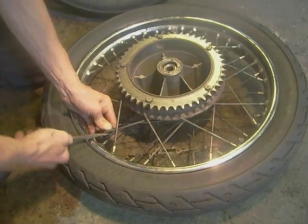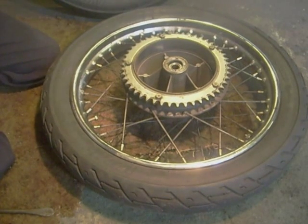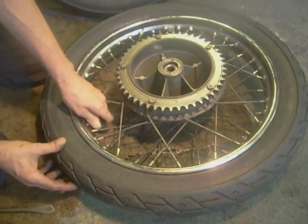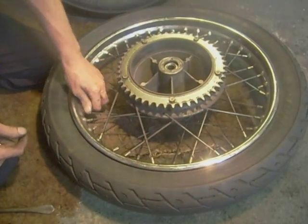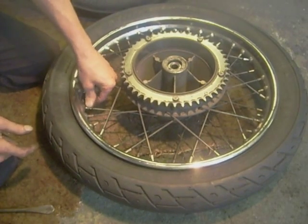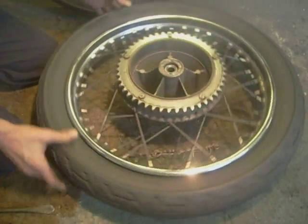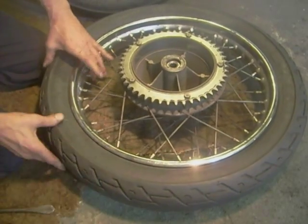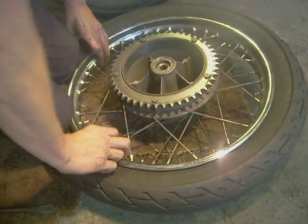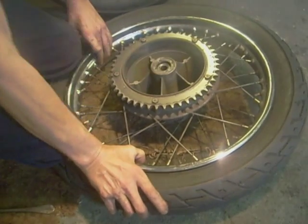Remove that — that's my homemade tire weight. That's a standard one. Take them off — I'll have to rebalance the wheel. I can take these nuts off now. I'm going to start near the valve around here — that's the side I'm going to pull over. Try and get this wall into the well. Make sure your grips are in so the tire will go nice and deep.